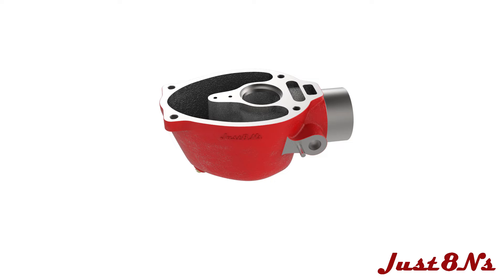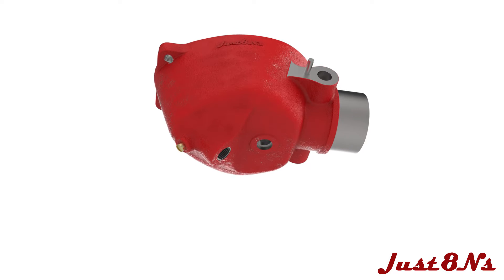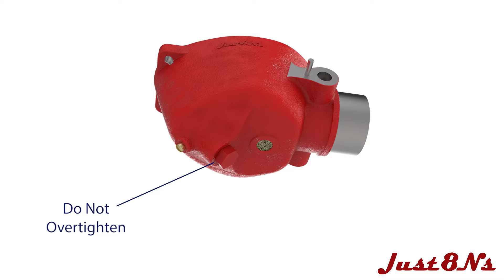Starting with the bottom half of the carburetor, or the bowl, look at the bottom face. The strainer-retainer expansion plug is not normally removed from the carburetor bowl, but if it needs to be installed, press it in the hole in the bottom of the carburetor bowl as shown. Screw in and tighten the drain plug. The drain plug has a pipe thread and must be snug to prevent fuel leakage, but be careful not to over-tighten as the carburetor bowl will crack.